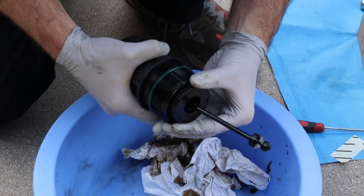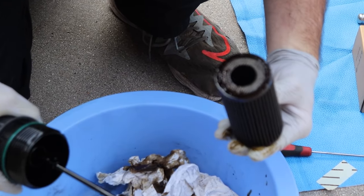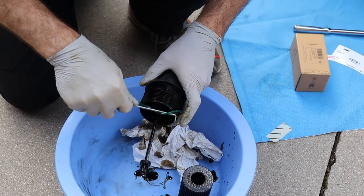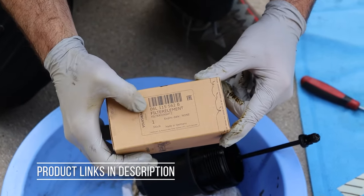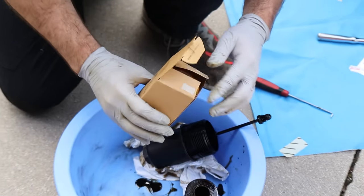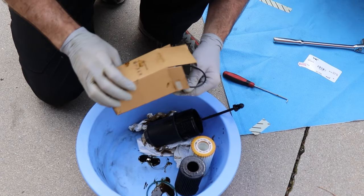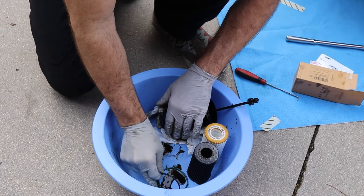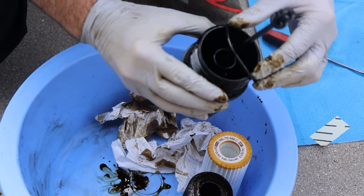The filter just kind of clips in there — just grab it and pull it out. Then you just get a pick tool for your O-ring and pull that off. We got our new filter here — OEM VW filter, we'll put the part number in the description below. They do give us the filter. It matches up nice, and they give us an O-ring. I like to just get a little oil onto that O-ring — used oil is fine. We'll go ahead and get that on.